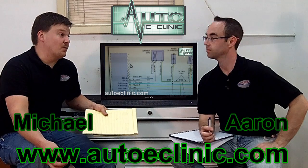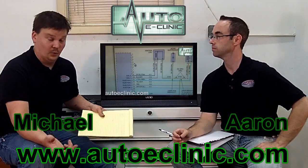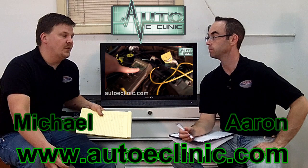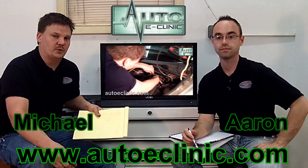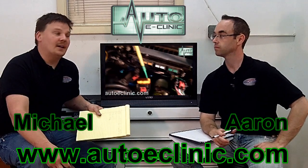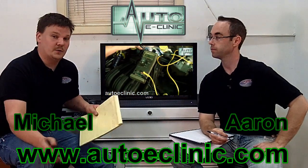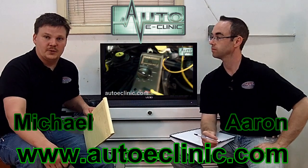Even if you get a PCM from Chrysler, it does not come programmed — you have to get it programmed by someone like Norris Auto Clinic that has the ability to program a PCM. That's the same with GM — pretty much all modules from about 2000 and above need programming. Even a junkyard module still needs programming to get the right information for the right vehicle, and sometimes you cannot reflash a module, so a junkyard item may not work. I've had a lot of luck with remanufactured computers — a couple of companies I deal with will flash them for me; I give them the VIN and mileage and they program it. Plug and play — very convenient and less expensive.